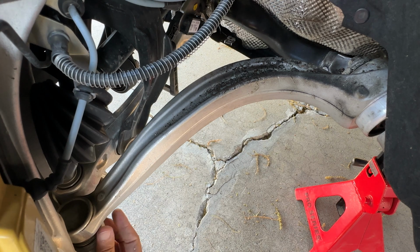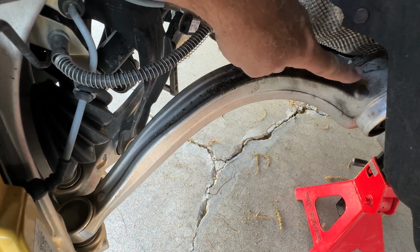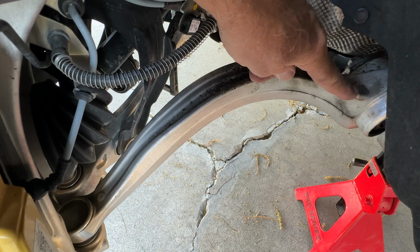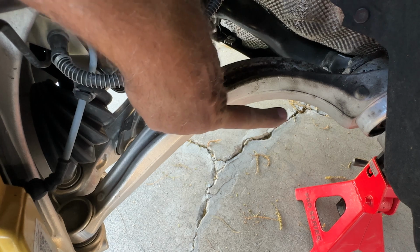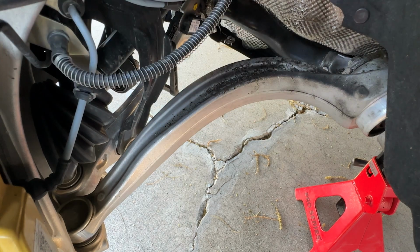So here we're seeing the rear link here, and this is its ball joint. And you can see that it curves around so that it doesn't hit the tire when it's turned, and mounts back here with a huge angular bushing. And that's because the rear link is the one that takes up any kind of reverse load that happens when you hit a pothole or something like that. It kind of turns that load into an inward pulse, and that big bushing helps dissipate it.